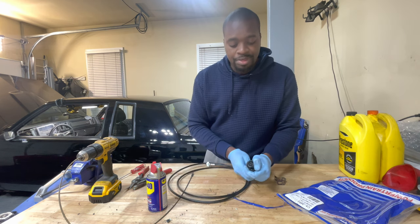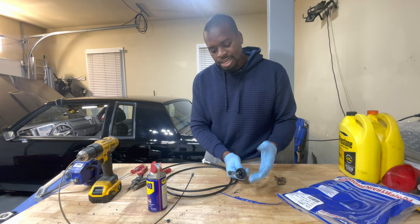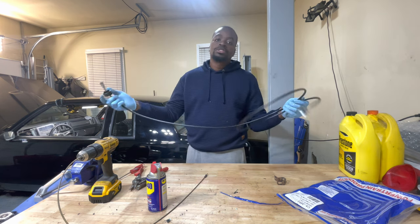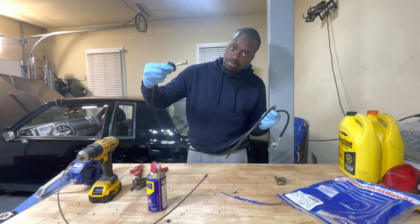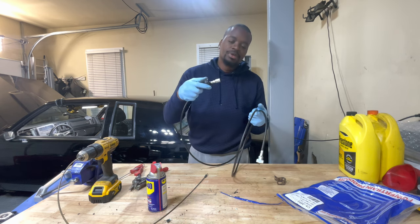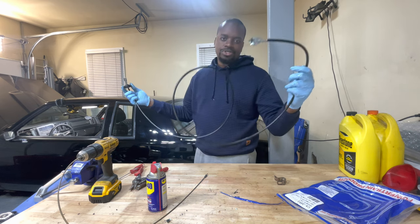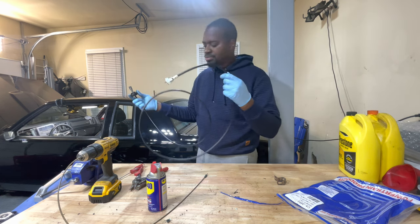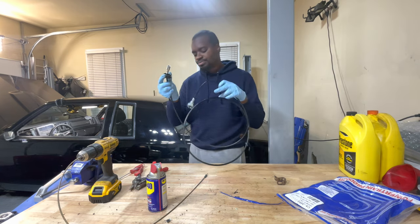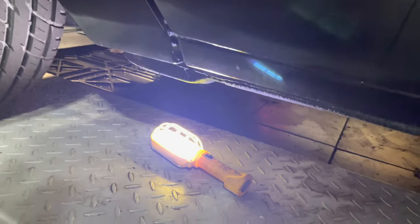Don't be afraid to help it by bending over some of that rubber so that it goes over the neck of the cable — and then there you go. When you install it, you go in from underneath the hood straight through the hole, you're going to plug the hole with this, and you'll have your path right into the back of the speedometer. Then you can take this side and snake it underneath the car, attach it to the frame, and then to the transmission.